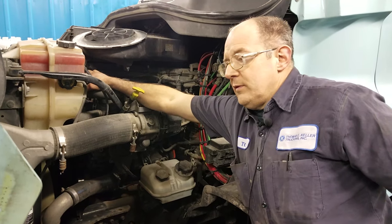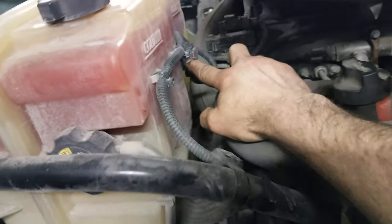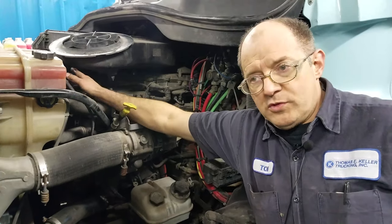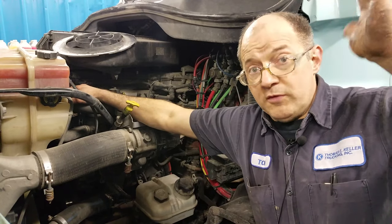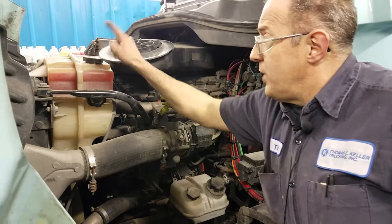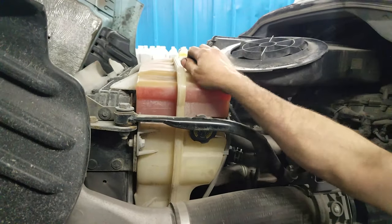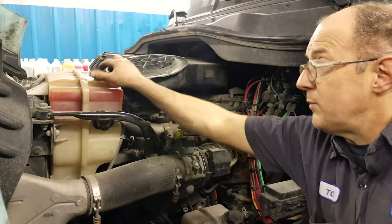Some people look and say you can see the sensor. But there's actually a coolant sensor right here — and that's actually a float in there, so it's still above the coolant sensor. But if it's down to the cold line, you will get a stop engine light. Take this cap off — never take this bottom cap off. It's awkward to get to, but this is your fill right here. This top is actually the overflow, like on your car. That's your pressure cap down there.